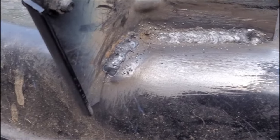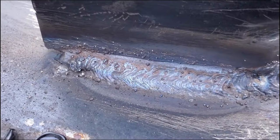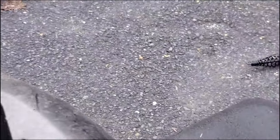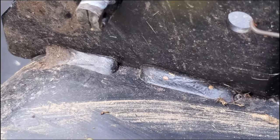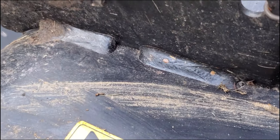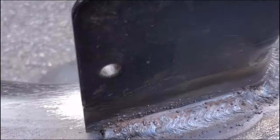Overall, this is a pretty good repair. There's a little bit more weld on this than what there is on the factory one — maybe that's better. They have these robots set up just right and know exactly how much they have to put on. On the beginning of this weld you can see a lot of metal laying there without much penetration, but it looks better at the back. I think this one here is going to hold better, plus having it welded on the back side.